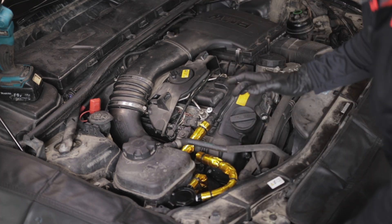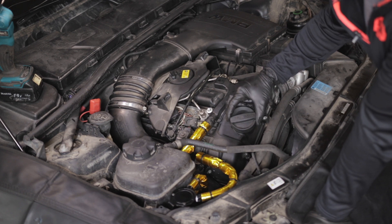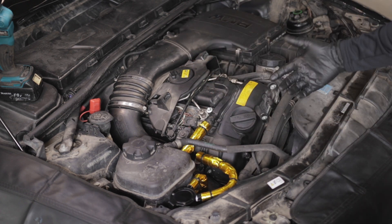There's one easy way to check that your vacuum is not compromised — just open the oil cap and listen for a vacuum. You hear that? That means there's still vacuum and you're good to go.